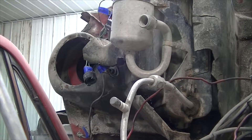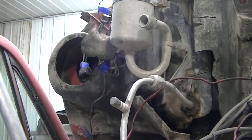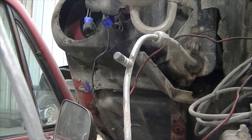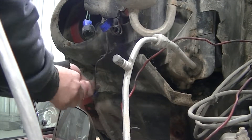I've already gone ahead and labeled most of the original factory harness. One of the other connectors is for the AC switch that mounts up in the evap housing. I'm considering whether to purchase a factory replacement harness and add power windows, since it's a Scottsdale model. It doesn't look like there are aftermarket harnesses that include power windows, so I may do a generic 22-circuit harness and terminate it myself.